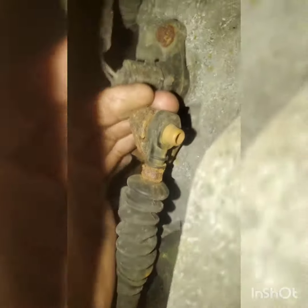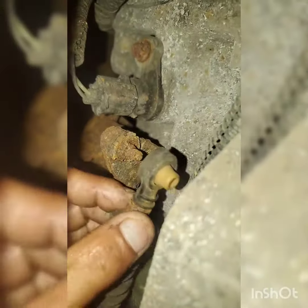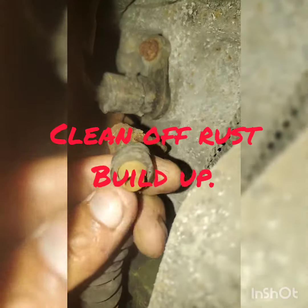Push it in. Put it in the gear you want. Go home. Turn it off. And then manually make sure it's on there and put it in park. But yeah, if your shifter cable pops, it's this. Look at it. Just replace this little bushing thing.